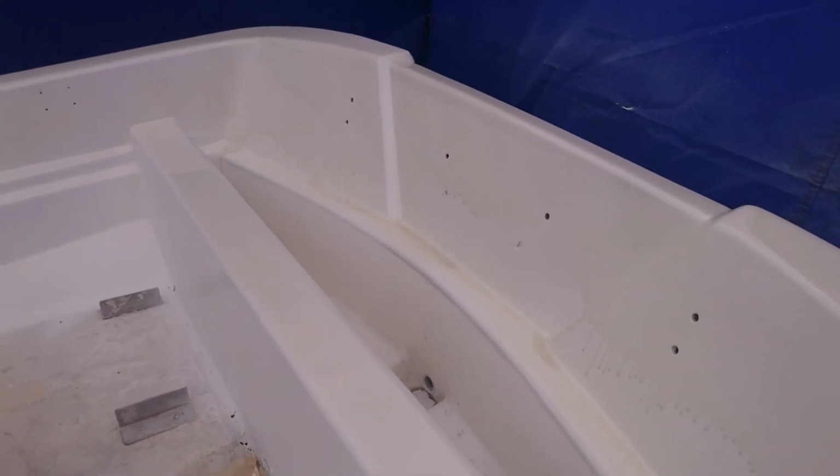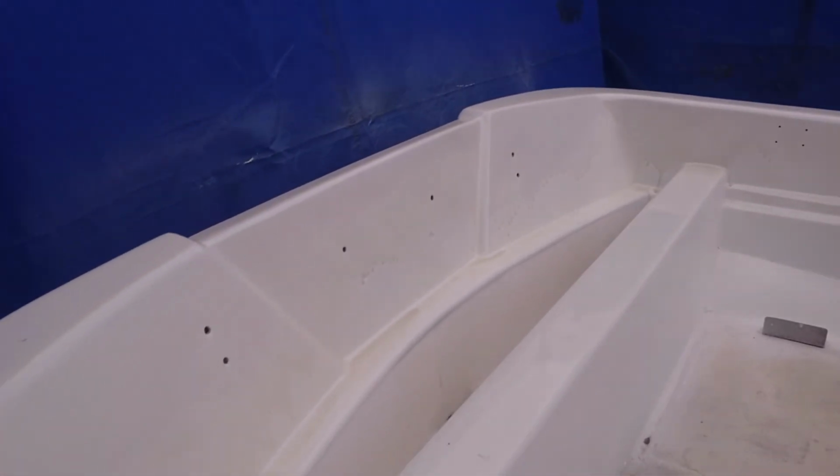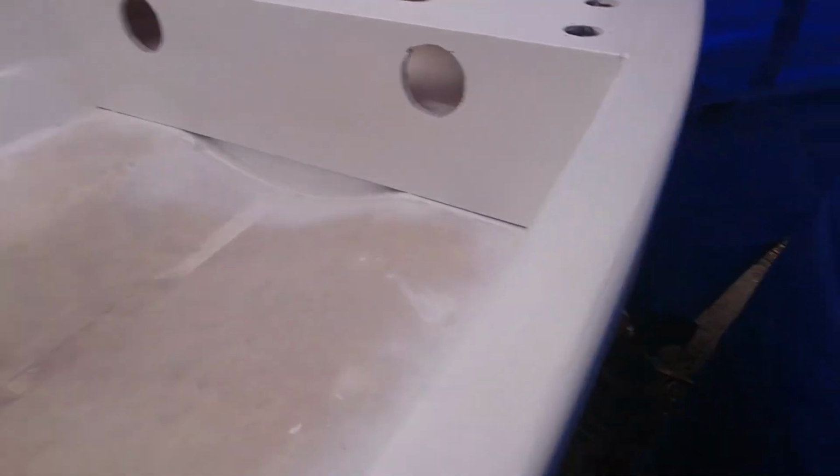Now, it's not showing it up in here. Yeah, don't worry, you can see how bad my painting is. That's the trouble when you buy a gun with a 1.8 nozzle. It's 1.8, it's huge. And unfortunately there wasn't a lot I could do about it. I tried swapping a nozzle from the other gun, and unfortunately it doesn't fit the newer gun, so I had to run with it. And I didn't thin the paint at all, or the lacquer rather. But yeah, this wind and weather we've got today is not helping. But it's done, so yeah, it's not the best. It'll have to do now. I'll go around sanding a few runs here and there. You can't see the colour yet until the sun comes out, but that is a blue pearl.